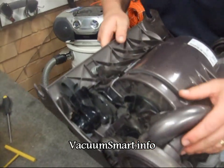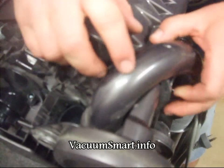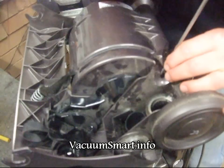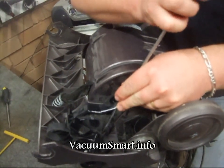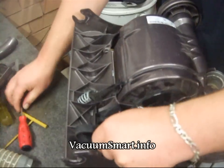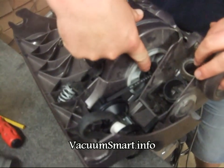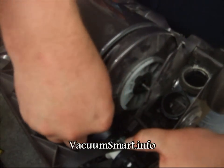The clutch has got three screws — one here, one here, and one which is hidden by the U-bend. So you lift that up and it's down there. You'll need a number 15 Torx driver to get at these. Once those are undone, the plate comes off, and now you can see that the clutch drive shaft belt goes from there to here. You need to unhook that and then use it to lift up the clutch assembly.